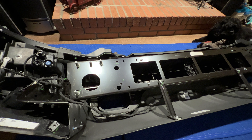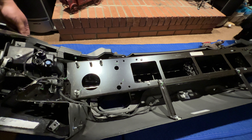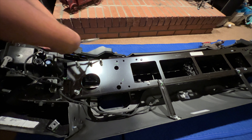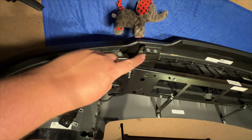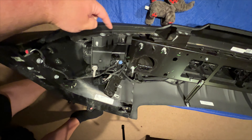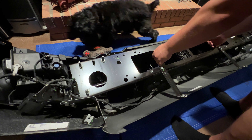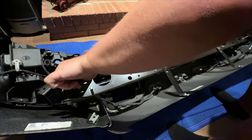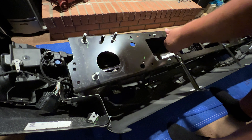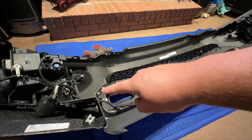Once we get that top trim off, this is pretty much ready to be pulled out. Easiest way to do this is to squeeze these clips — you can do this with needle nose pliers or pretty much any pliers. These are just on here with rubbery clips, so you can just squeeze and pull out. With that off, you can see there are three T40 bolts that have to come out. The two over here are just for the fog light and those don't need to come out.